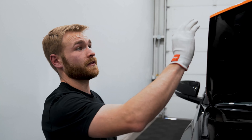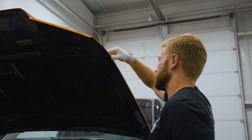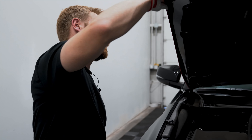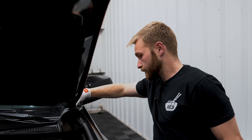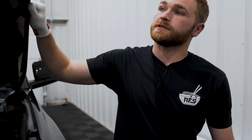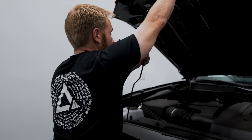We're almost done with the hood now. Now that we have this front edge done, the last thing we need to do is go around our side edges and ensure our edges are completely rolled and pushed down. All that takes is your wrap glove going back and forth in small increments so you do not crease — if you try to go all the way around the edge in one go, you will crease it. And just like that, all of our edges are rolled, our corners are shrunk, we have no creases on our corners, and the hood is good to go.